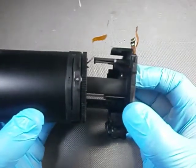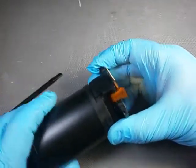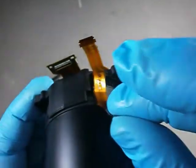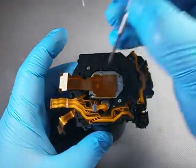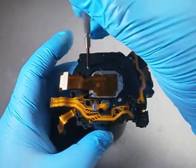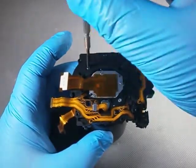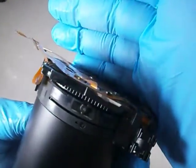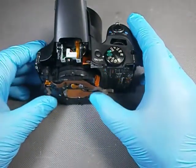Let's restore the plastic support to the back plate. The back plate can now be attached to the inner cylinder — we pry this tab upwards with the spudger while gently pressing the back plate against the inner cylinder. This flat cable must go in the guide like that. Pro tip: when tightening screws into plastic, turn them counter-clockwise until you feel they have caught the thread, then turn clockwise, assuming a normal right-handed thread. We need to fit the two tabs of the flat cable between these two hooks, then proceed to install the lens assembly back into the main body of the camera.